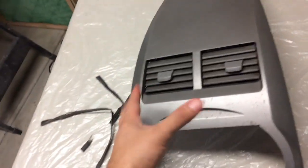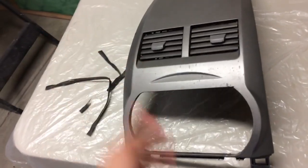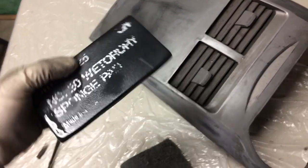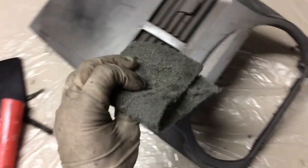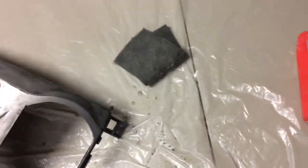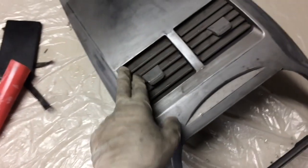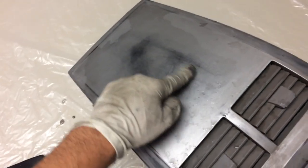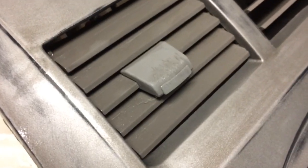So that's the look I'm going for. This is the piece that goes on top — this is where the radio is. I've sanded this whole thing down with a 400 grit using one of these soft wet sponges. For areas like this, I'm going to have to use one of these gray scuff pads with this product right here — it gives a little bit more scuffing power. Areas like this and all these little crevices, you can use the gray scuff. Areas where you see black, that's where you can spray some of the plastic primer.